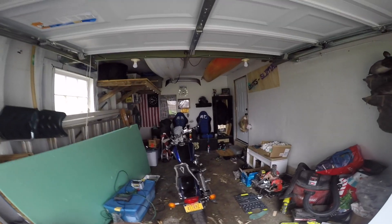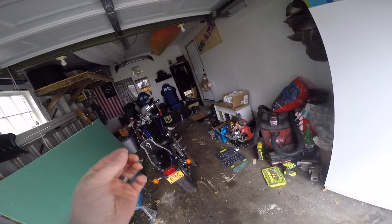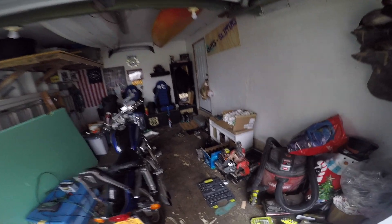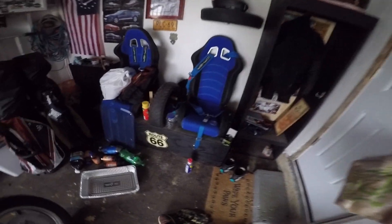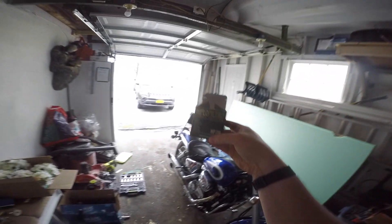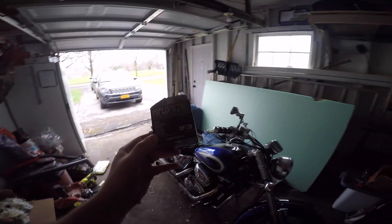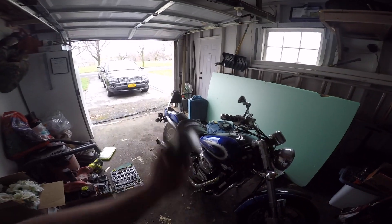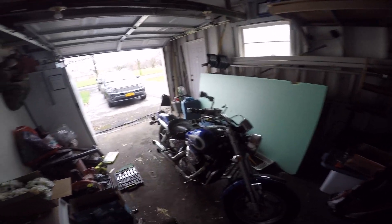Hope you all have a great day. This will probably be part of a bigger video, so if it's not, this is your friendly neighborhood moto vlogger saying: make sure you get all that old oil out — or as much of that old oil out as you can — every time you change your oil. I went with a high-flow filter on this build, simply because it is a great filter. It's a high-flow filtro — this bike takes an HF138, and it is a really nice filter. Change that every year when you change out the oil, or just every time you change out the oil, and you'll be good to go.